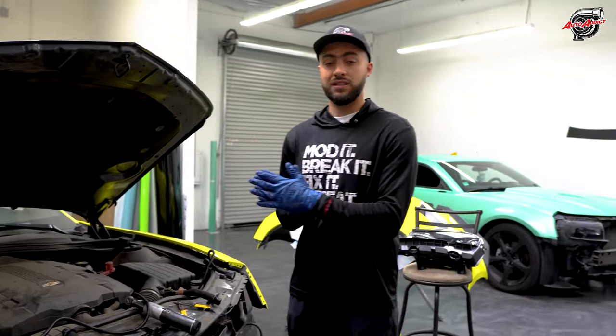All right, guys, when you get the headlights for the 6th gen, and you have a 10-13, the OEM packaging box comes with an external harness. Please, I repeat, please do not use this harness. Every time you use it with our T-harness, if you're a 10-13 owner, you will blow a fuse. Let me show you guys why these don't work, because this is an aftermarket headlight harness for the 14-15, and this is built to function like your OEM functionality for the 10-13.